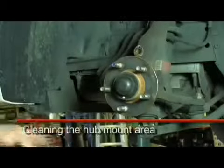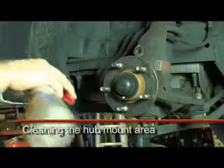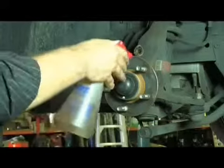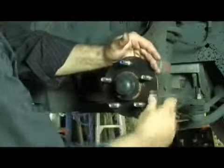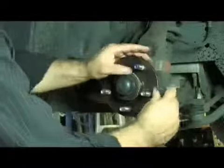It's very important that this rust is removed before we refit a new disc to the vehicle. We're going to use some coarse emery paper to get the bulk of the rust scale off. But first, we use something like WD-40 or an inox material to spray on there, just to lubricate while we clean. Give that a liberal coat — be careful not to get it onto the pads. Then we basically work our way around and remove as much of the rust scale as we can in a bulk way.